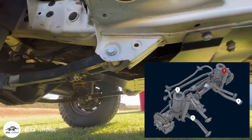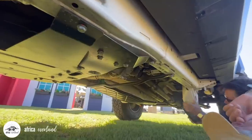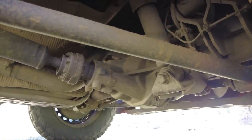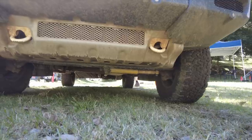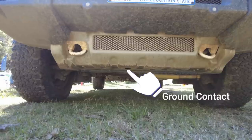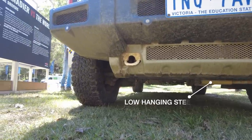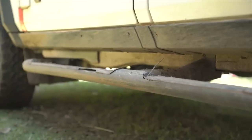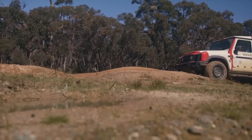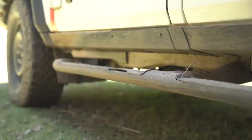The front has a five-link suspension, however with very short lower control arms, so I'm wondering how the car behaves when you lift it more than two inches. I also noticed that the driveshafts have compound angles which may be an issue if you lift the vehicle. I think the constant velocity joints on the driveshafts are a good thing — they're easy to replace and they don't get hung up. Looking at the front, it's good to see two recovery points and a solid bash plate, however the low-hanging bash plate already had some good contact with the ground and the steering dampener hanging so low is also a concern. The Grenadier we drove had side steps and rock sliders which looked pretty well used, given I haven't seen much really technical driving footage of the Grenadier — it just shows the rock sliders have fair contact with the ground even at pretty easy driving, due to the ramp-over angle.